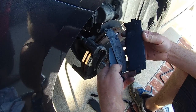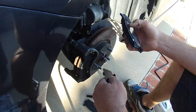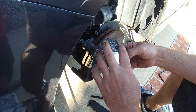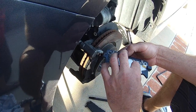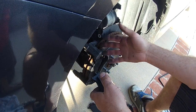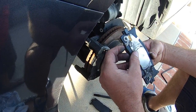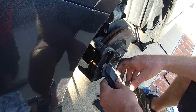I actually had a Mazda where I was chasing a brake squeak. Somebody had replaced the brakes before me and left off one of the shims — it was a two-part shim. And that thing squeaked every time I took it for a ride. I was trying to find the squeak. I resurfaced the brand new pads, resurfaced the rotors, took everything off, re-cleaned it, put it back together three times — still squeaked. So I ordered a hardware kit, got it, and realized there was a second shim missing. And because of that missing shim, the brakes squeaked.